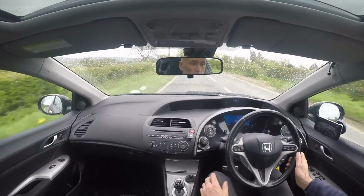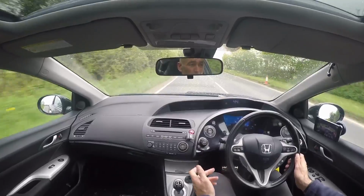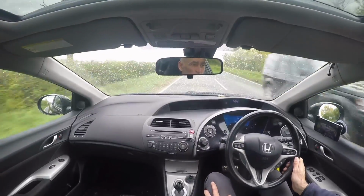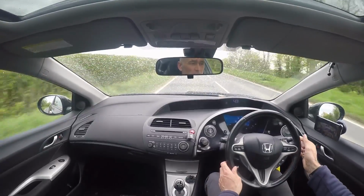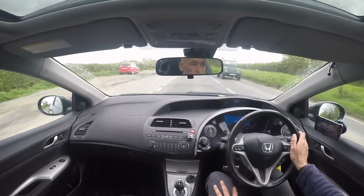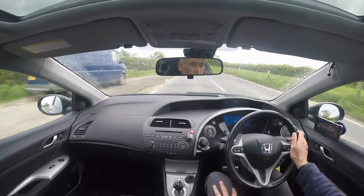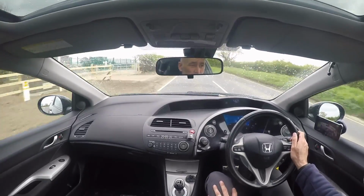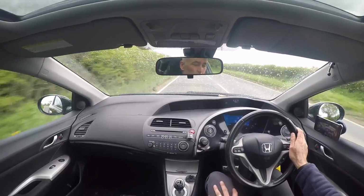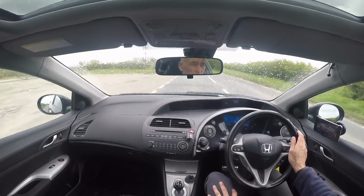And what I try and do on the road tests is just to go through the car step by step, much as you do yourself. Starting with the engine, good place to start on the Hondas. This is a 1.8 Vtec engine, very smooth, starts absolutely on the button, very sweet revving. It always are. It's a lovely sporty engine actually. There's no warning lights related to the engine or anything else for that matter. Car's running a temperature at the moment of a third of the way up the gauge, which is exactly where it should be.